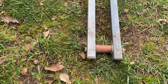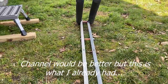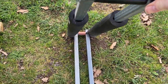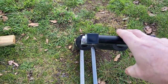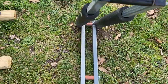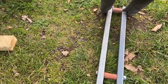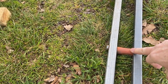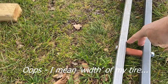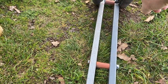It's made up of a couple of lengths of galvanized 25mm square tube. This end bit — the tire fits in here, you clamp that over the tire, which gives it a bit of stability while you're strapping it down. I run a tie-down strap around there and then around the head tube of the bike and strap that down firmly onto the front wheel. To protect the wheels I've used PVC electrical tubing, cut to about the length of my tires, and used some screws to hold that all together.